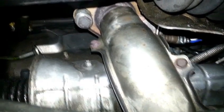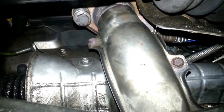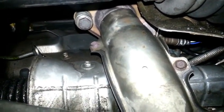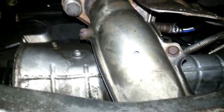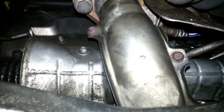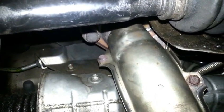Remember the key: don't have that spark plug or oxygen sensor in place. Because when you do, you can't get the bolt that's next to it lined up. Get these squatter bolts — they have less depth to them. That'll make your life a lot easier.